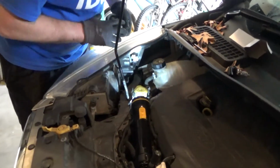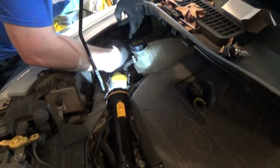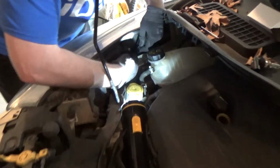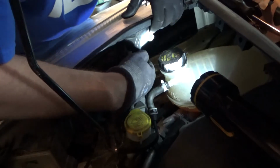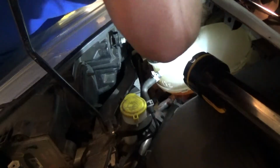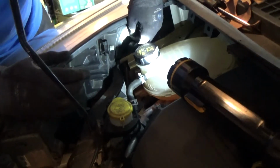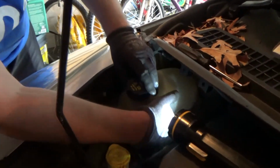After you double check the light is working, make sure you lock this grommet really well so you won't lose it on the road. It actually goes in pretty much only one right way. There's a groove in there. Make sure it's tight, maybe try pulling it gently. Okay, and after that replace the reservoir.